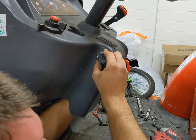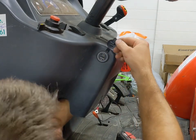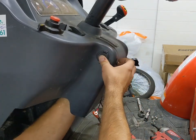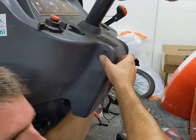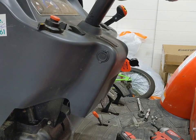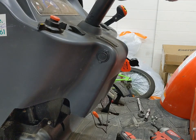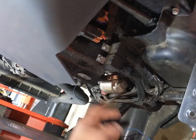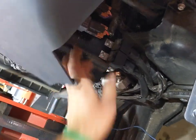It fits pretty nice in it actually, with zero play at all. I'm going to get this nut snugged up on the back side here. It's plastic and made of chinesium, so you're not going to want to reef this down real tight. It's actually got a rubber seal on here anyway, so that's going to help kind of snug things down a little bit. The rubber will kind of crush and actually help hold it on — so it's not like you need a pair of pliers to tighten that down. Now we know how long our ground is and what our options are for the ground wire. That spot at the relays where it self-taps right into this sheet metal firewall is probably our best spot for a ground.